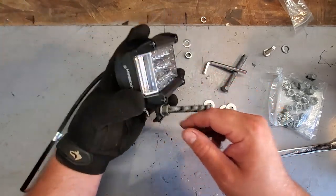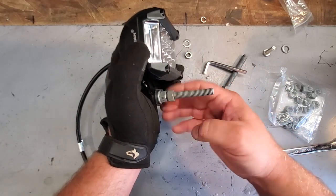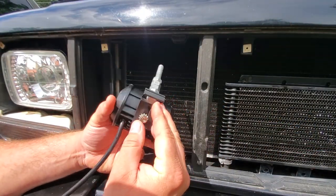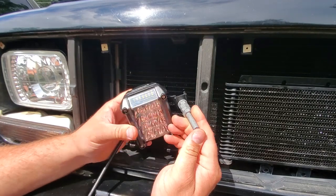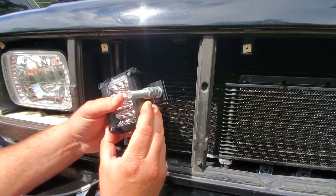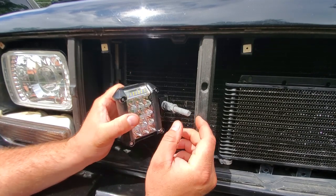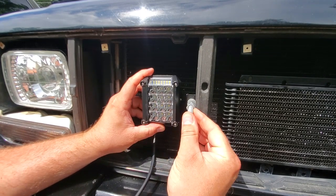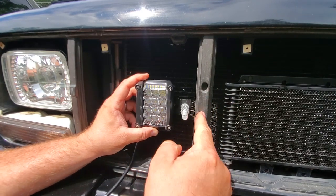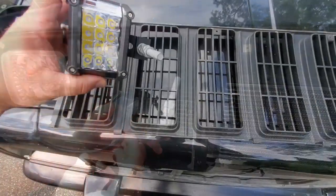Here is our side shooter turned into a top shooter. I'm threading down some nuts to give the spacing as needed. Got my hardware mounted up — the bolt is trimmed out with nuts for spacing. I press this deep into the bracket slot, slide the bolt through. This needs to be cut down to size — I can probably lose a good inch off it. I'll cut that off, drill a hole in the header panel, fish this through, and bolt it up.